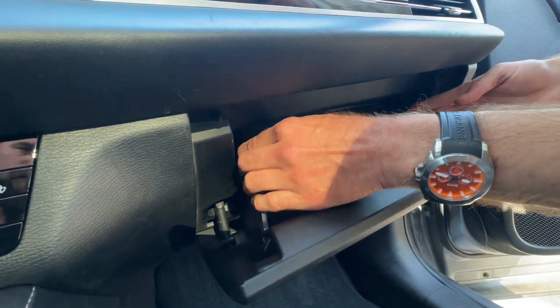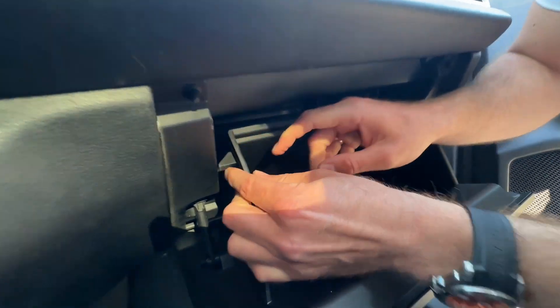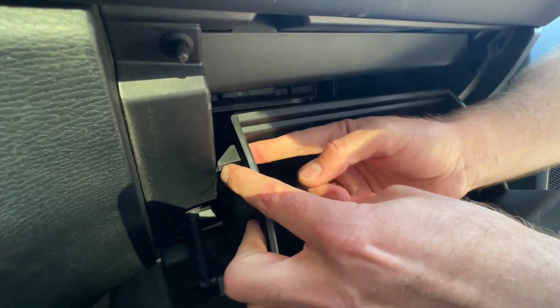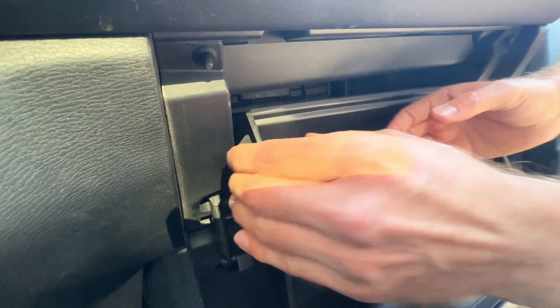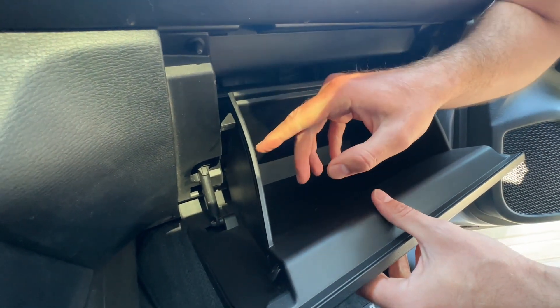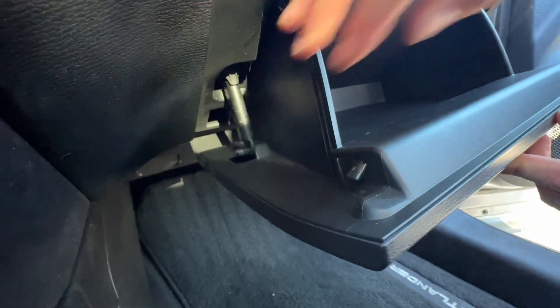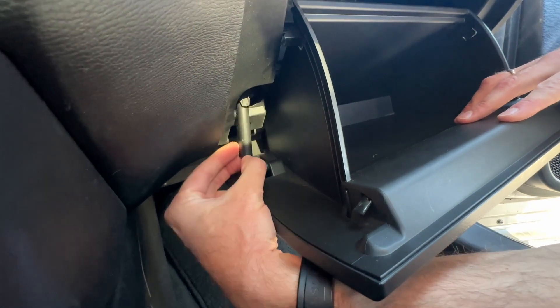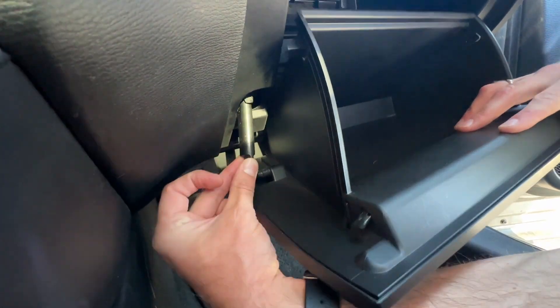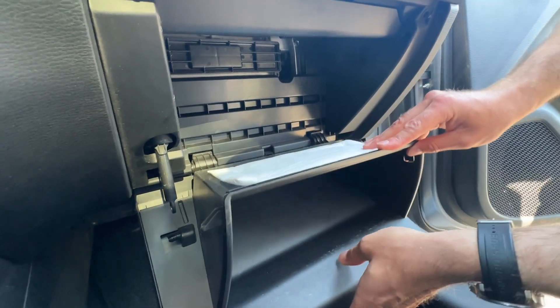You can see there's a clip from one side and a clip from the other side — it's like a pin or clip. You squeeze it a little bit and this one unclips. Once you've done that, there is this part right here that looks like some type of shock or dampener. You just remove it from here, and this allows you to drop the glove box all the way down.